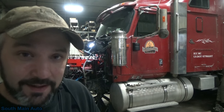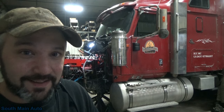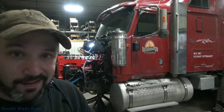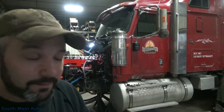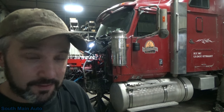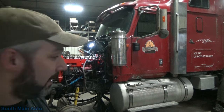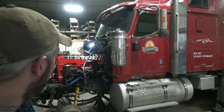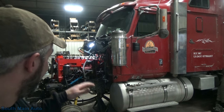It's 600 horsepower on this engine — bone stock, and it lived to almost a million miles. When they get an in-frame, they get new pistons and sleeves, rod bearings, main bearings — and yes, they do mains on this too, as well as the oil pump.